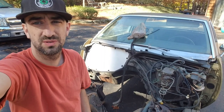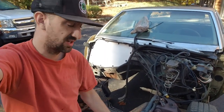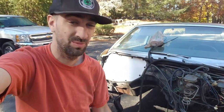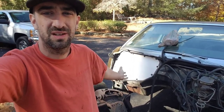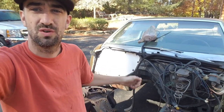With one of these G-body cars going from a V6 to a V8, you've got to switch the frame stands. I already took them off this car and luckily I had another set of V8 ones laying around in the dirt for the last six years, so it didn't cost me anything. You can typically find these for like 50 bucks on marketplace, or get some aftermarket ones cheap. Cutting the bolts cost me $6, and I've got a $35 AC block-off plate going on underneath the hood.